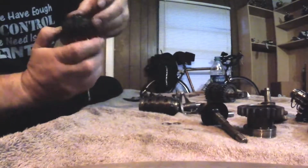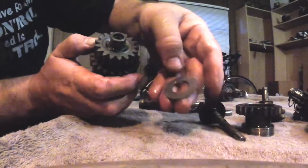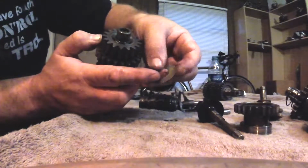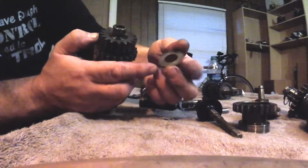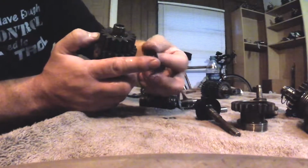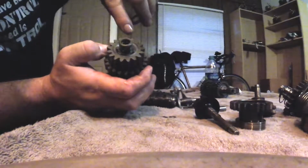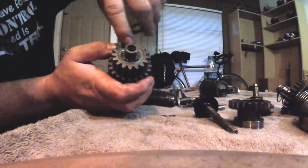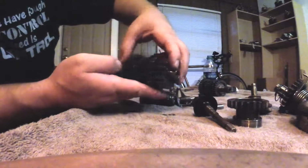Let's see which way it faces. You can tell from the score marks on the washer which way it faces. See that pattern? That correlates to either the bearing or edges that rub. See how that's got a nice smooth wide spread load on it? That's because it runs against a bearing that's spinning with it. See how this side has 4 or 5 distinct different rings of scoring marks on it? That's because you have 1, 2, 3, 4, 5 different levels of metal and heights of metal in there rubbing around on it. So that washer obviously goes on in that direction.